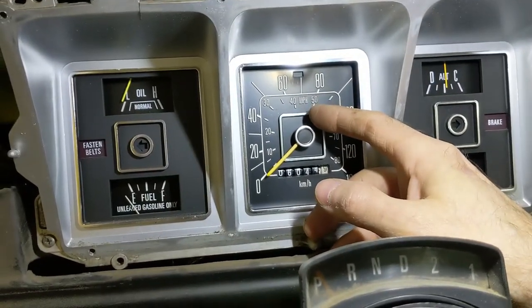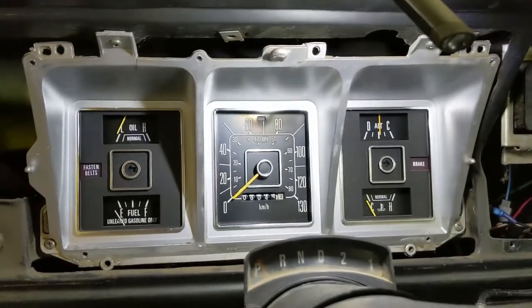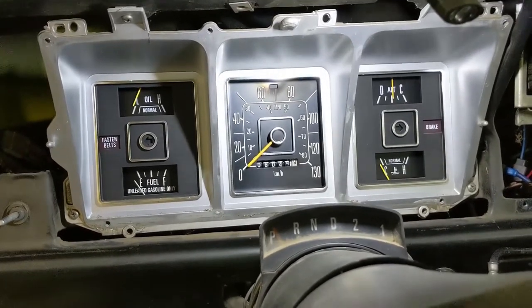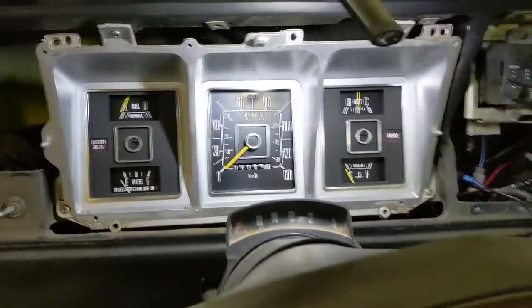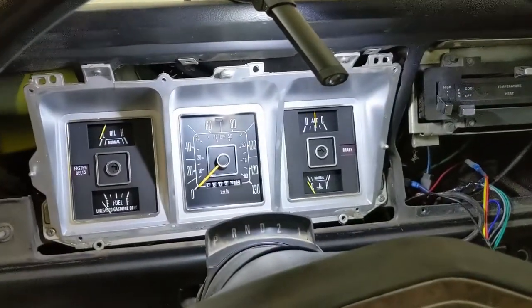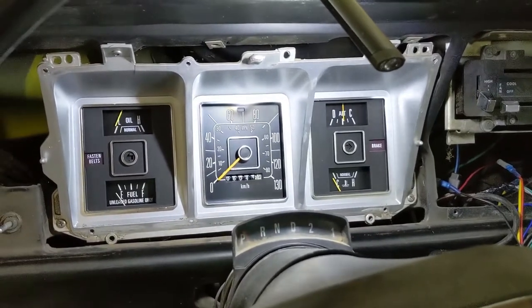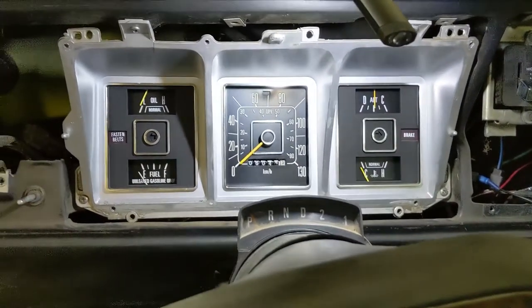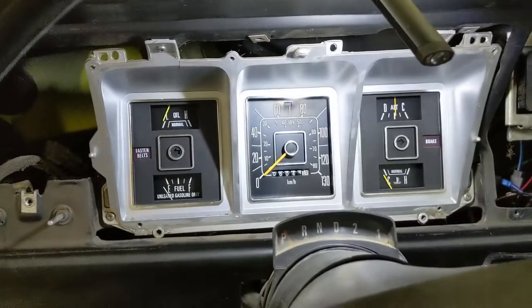I'll get that lens cleaned up and put back on, then calculate the gears I need. First I'll take it for a test drive, and if it's not right I'll use a GPS odometer while traveling to check my speed against what's showing. I know I have an orange drive gear, I know the tire size, and I know this is set at zero again — so now it's about determining the driven gear, which is the smaller gear on the speedometer cable.